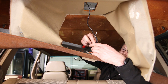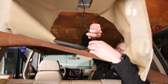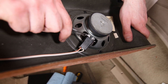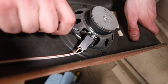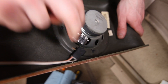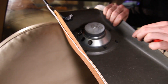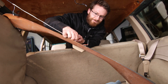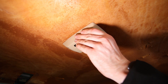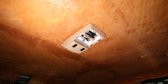So here's what the headliner used to look like — you've got a connection right here for the light. To disconnect the speakers, you just want to lift up this tab right here, clipped over the back. Last, I'm going to disconnect this middle light right here.